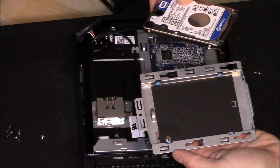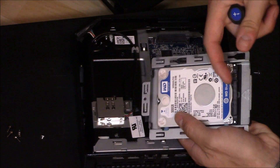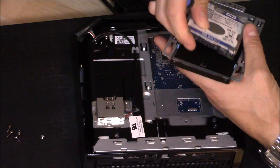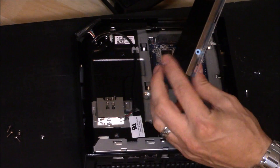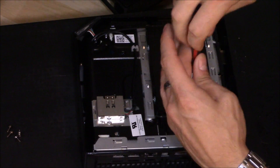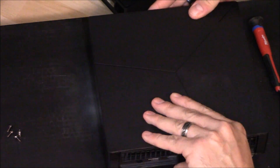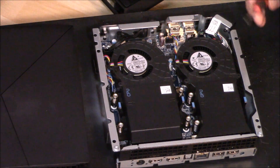You got the hard drive just like that. Once you put the other one in, put it in like this — make sure the ports are facing this way — and just line up the holes. That's how you install the new hard drive; really easy. Now flip it over and you can take out the top. This thing is so easy to take apart — it's really fun to work on.